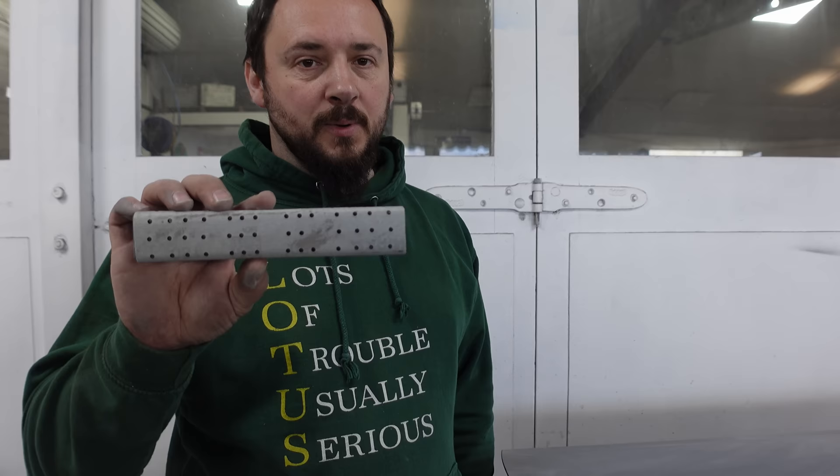So any little wobble or imperfections are going to stand out like a sore thumb. I hit my primer with some 180 - that's extremely harsh. But as long as you go down through the grades and you're confident that you've got the scratchy lines out from the last grit, then there's no problems. Just be gentle. So I've hit this with 180, 240, and 320. This is now ready for a wet flat with some 600 and then it's ready for paint.